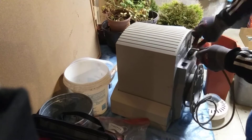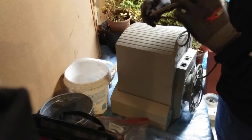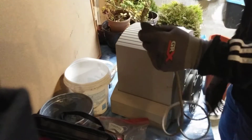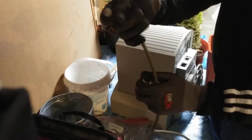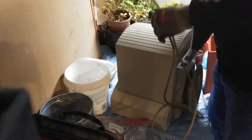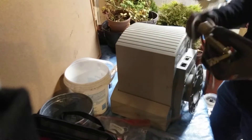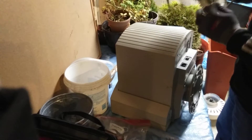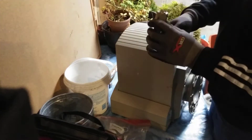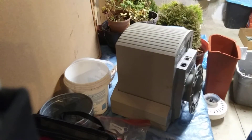We're going to start off by getting this cord off - just cut that right there. A good little tip for anyone just starting scrapping: whenever you're cutting any sort of plug for scrap, the more insulation you can leave on, the more money you're going to make. Not every yard is going to allow you to do that, but some will, some won't. So we've got a nice piece of number two insulated wire right here, and the gold pin connector, which can range from 50 cents to a dollar depending on who you sell it to.